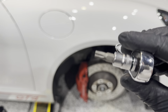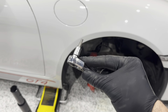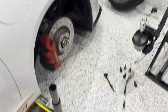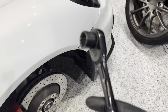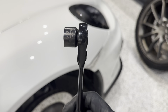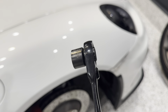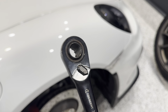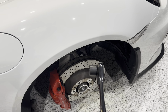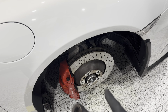We're going to tackle the sway bars first. I'll put links in the description for some of these tools because you're going to need them. First is a T30 Torx — if you're working on European cars you'll need a set of these, and probably a set of E-Torx as well. Then a 16mm socket or wrench. I actually have a pass-through socket, which is really cool. 16mm is also five-eighths of an inch so you can use those. I'll show you in a second how we set this up — you can put the Torx through it to hold.